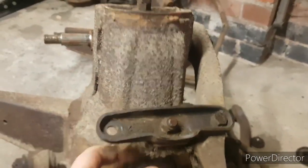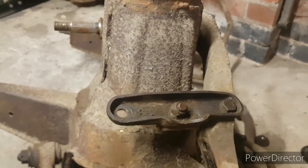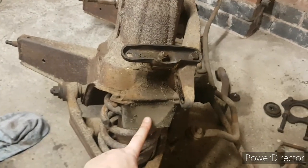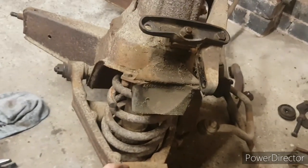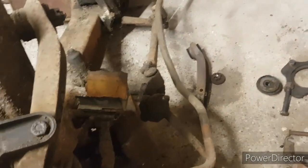We'll get this bracket off, split the old bump stop off it. That'll all want replacing, and that's basically the top done. Then I'll get the main lower bump stop off. Then we can start thinking about the lower wishbone spring pan. Don't know if I get onto the steering assembly tonight. Possibly, possibly not. We'll see how we get on.